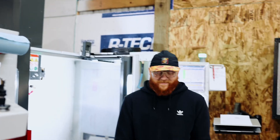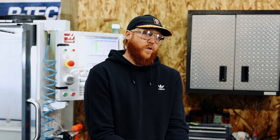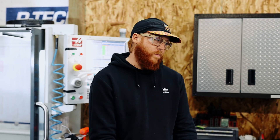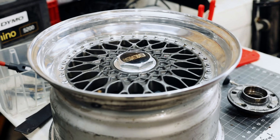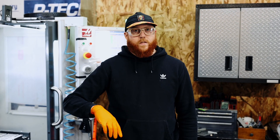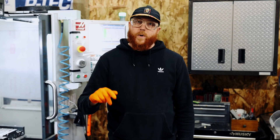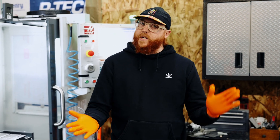Alright guys, this is my buddy Danny. Danny's going to help me out with these wheels. Danny, you want to tell them what we're doing today? Sure — modification always requires extra work, especially for doing cool stuff. So basically this wheel bore is about perfect for the Mustang, but the problem is the Mustang bores sort of have a taper to them. Long story short, it doesn't fully seat on the hub. So we're going to take them into the machine here, cut a chamfer around the back, and basically give it enough clearance so that it can seat right down and actually work as a wheel.